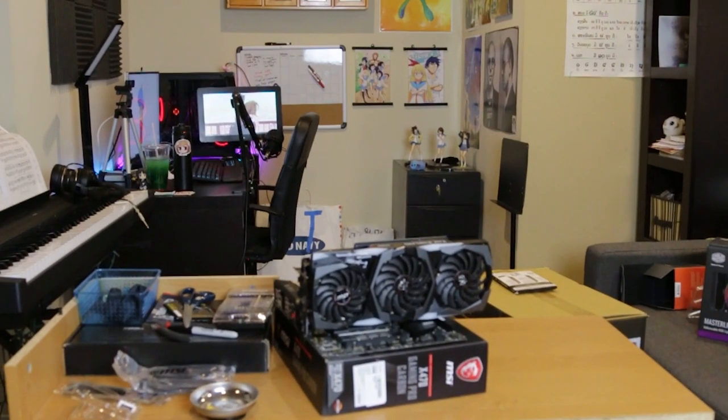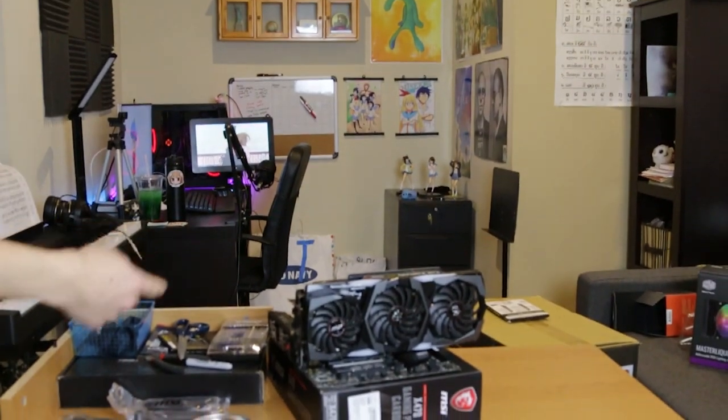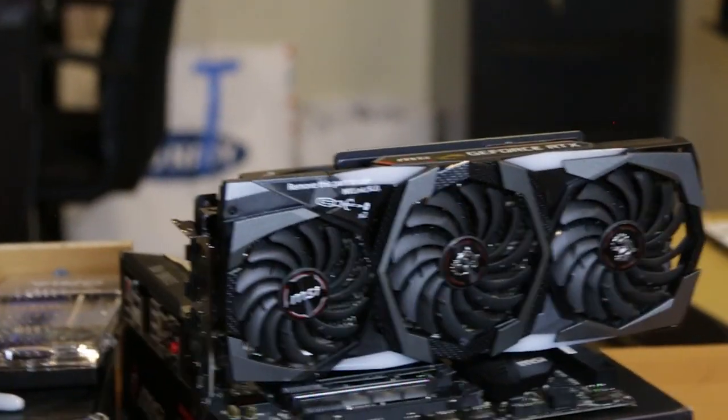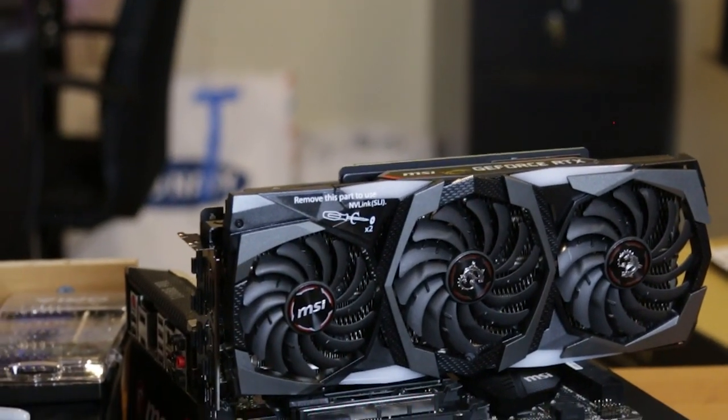And wait. What? Oh, never mind, the NVMe. Yes, that drive is in. I don't need that drive yet. I'm actually gonna put that in last because I'm gonna cheat because I have two drives. I'm just gonna leave it out so that when I install Windows, it's forced to go to that NVMe and not accidentally onto the other drive. Life hacks. You're doing a smart.